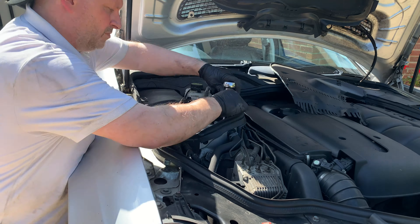I've removed the old shock from the car. The problem is one small thing I forgot - the dust cover inside. I'm going to need that. Unfortunately that means I've got to compress the spring, take the top off, decompress the whole lot and then take the dust cover out - which is a lot of faffing around just for the dust cover, where I should have bought them with the new shocks.